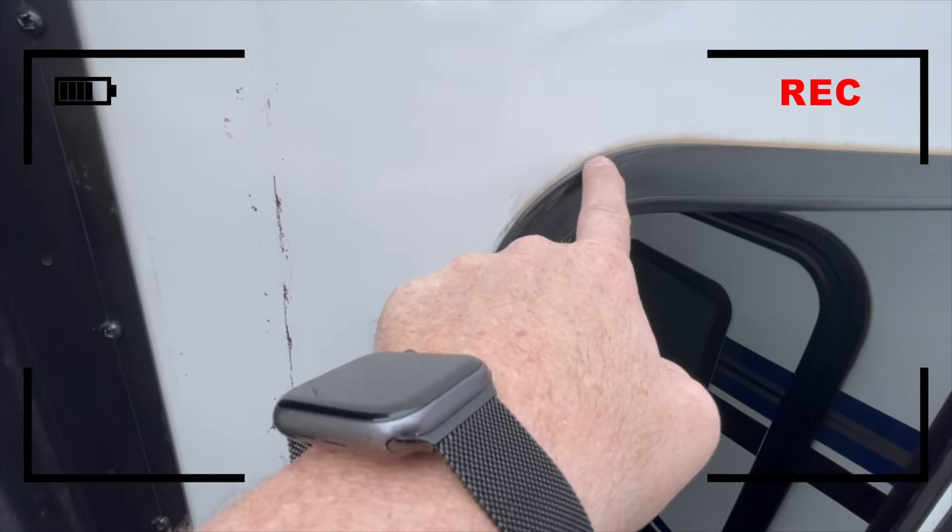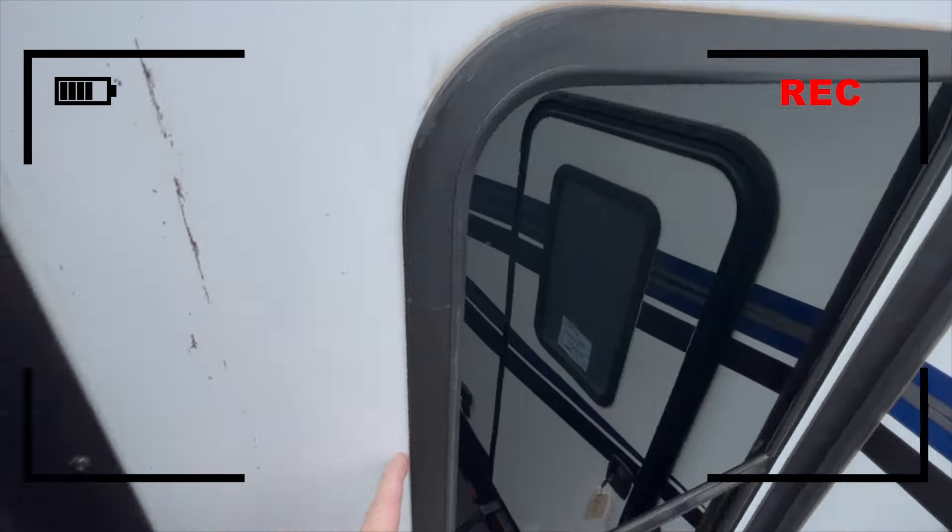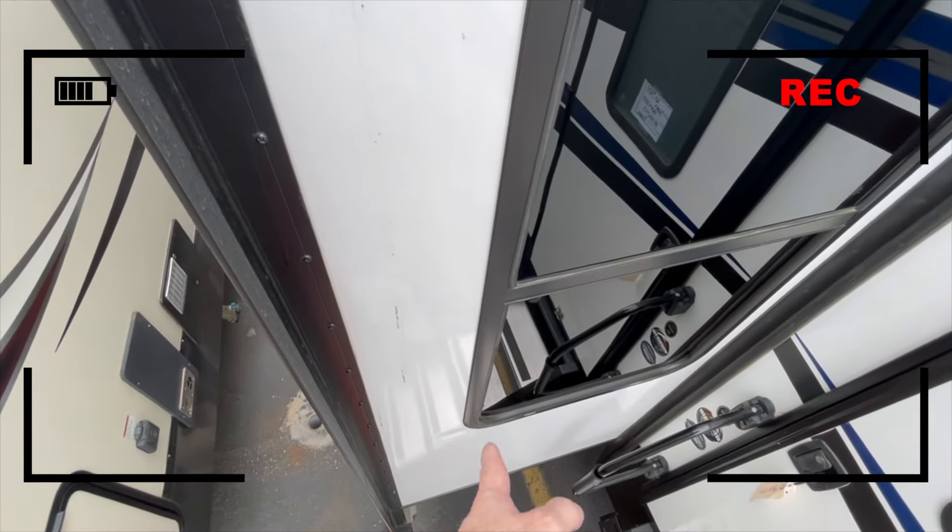For example, a window — a lot of times they won't reseal around the whole window. They'll just do what's called a cap seal, just the top edge, to try to help deflect the water. Or if you look at certain sidewall moldings, they'll seal the whole sidewall molding. Sometimes they'll seal around the entry doors, but a lot of times they won't seal all the lights or all the way around something, or the moldings or the hatches and the latches or the catches or the handles.